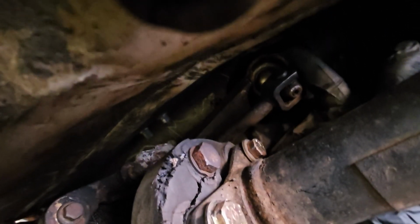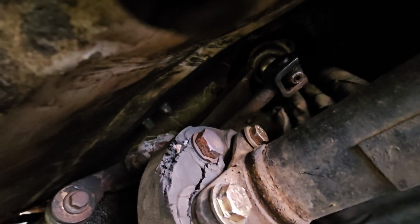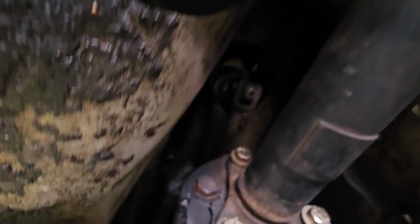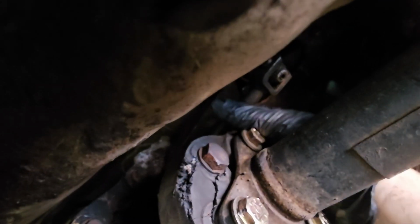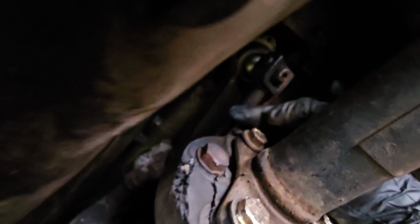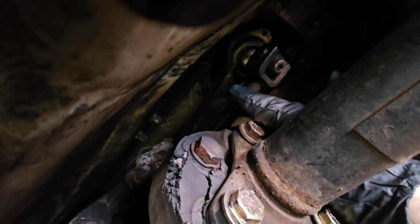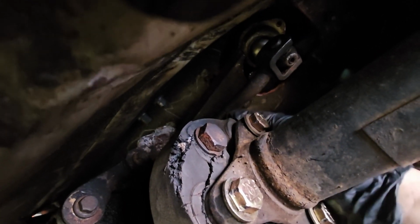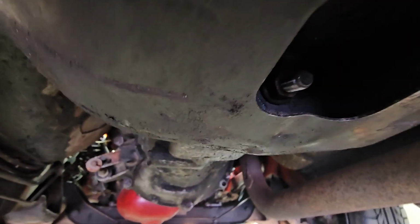The shift tower is now shifted to the driver's side. It used to sit like right where my hand is, and it all got bent when that drive shaft flung around. And this shaft has a tiny bend in it that is making it angled wrong. So I'm going to work on this later today, hopefully. Try to get the pin out and take this whole shaft out and torch it. This was only on the first 2 threads. I cranked that down.